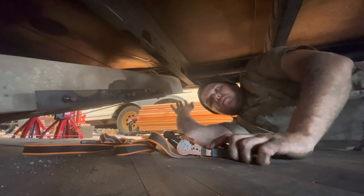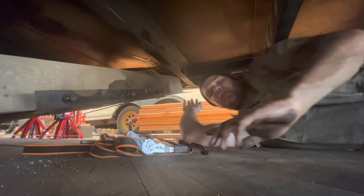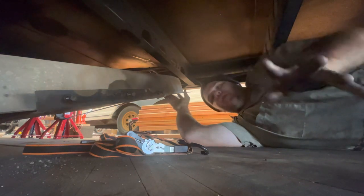On top of the tank, there's zip ties and stuff on mine holding the wire harness to the fuel lines. You're gonna want to cut those and get everything free before you actually let the tank fall all the way. My tank's one corner right now is being held up on the other side, out of the camera's sight right now. But you want to make sure you're not holding the tank up with just wires or fuel lines. You're going to break something.